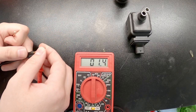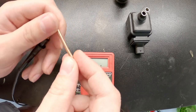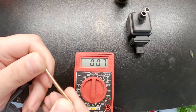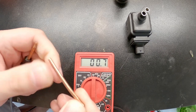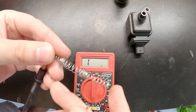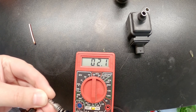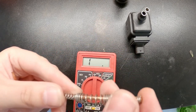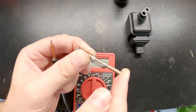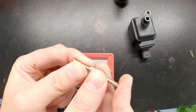Let's get our baseline — 0.7. Now let's check this copper piece. Wow, look — there is no difference. That means there is no additional resistance created by this between the two probes, unlike our spring which is around two ohms of resistance. I've made the length of these copper pieces just right so that when they're pushed together, the spring actually compresses. So there is solid metal-to-metal connection between coil and spark plug, with a solid piece of copper going straight through touching both ends.